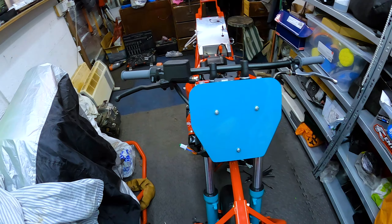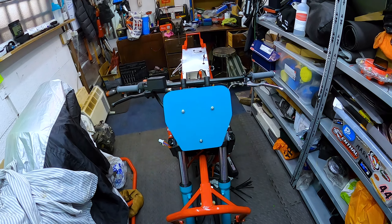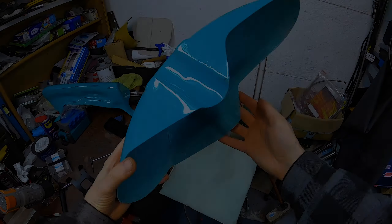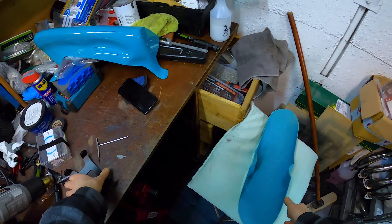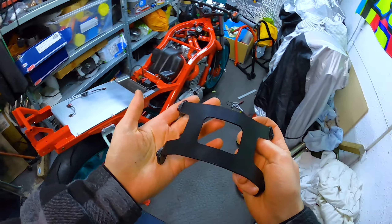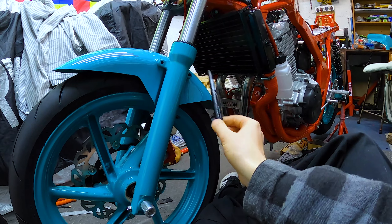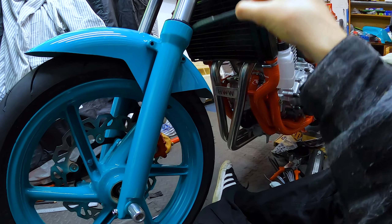That's gone fairly evenly. It's quite nice to see the bike have a face instead of just looking at bare wires all the time. For the front fender, the longer piece goes at the front and shorter at the back. There's a fork brace bracket that goes inside it — squeezing through, it goes in between there. I lined it up on the bike and there's a slight ridge where it wants to sit, so I just stuck a pen in and put some dots on either side.